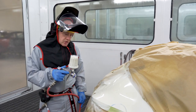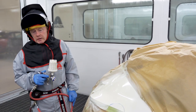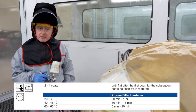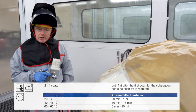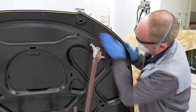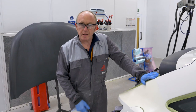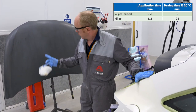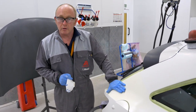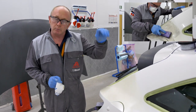That's the application done and as you can see it was very quick and very easy and has left a very smooth surface. Ordinarily I could leave the car in here but as we need this cabin for another job I'm going to put this outside and leave it to air dry for around 20 minutes. During this time I'll prepare the bonnet for the wet on wet and I'll mix my colour ready to do the job. The car's now been standing in the workshop for 23 minutes and in that time I've managed to prepare my bonnet for wet on wet — my colour is mixed and ready to go. Now just like any normal 2k surface or filler I'm going to sand this in readiness for the top coat.